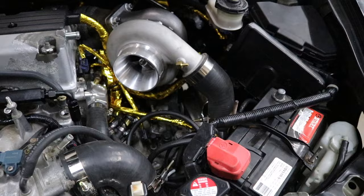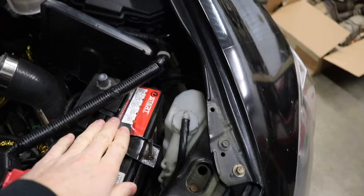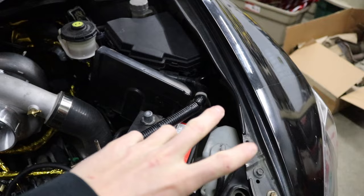The way we have this check valve mounted is down under the ECU. So we've got to get the battery pulled out, then cut the zip ties on the lines, get the check valve pulled out, flip it around, get it reinstalled, and get the battery reinstalled.